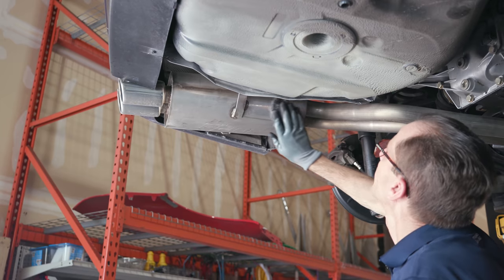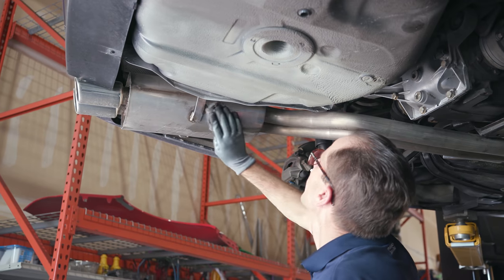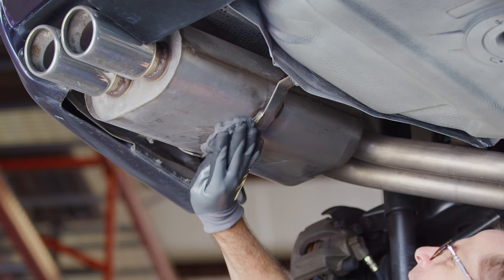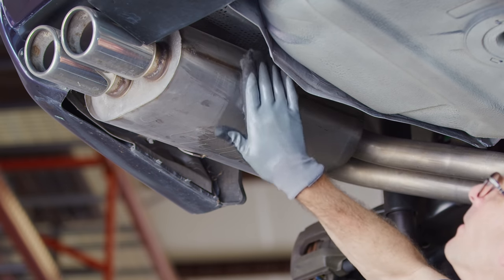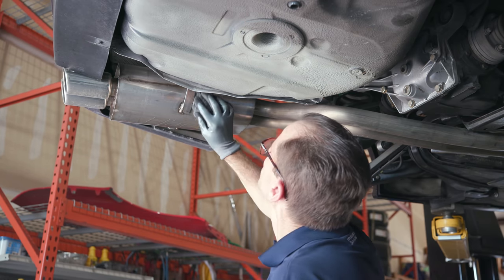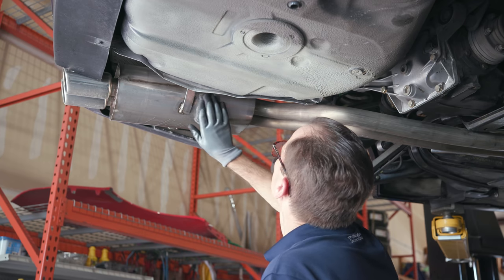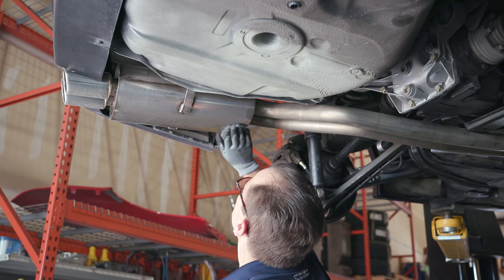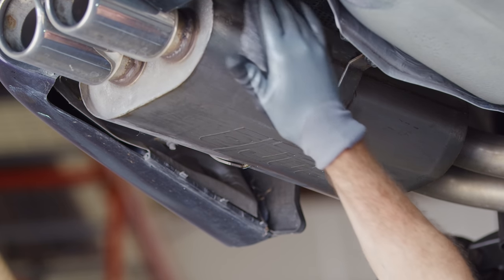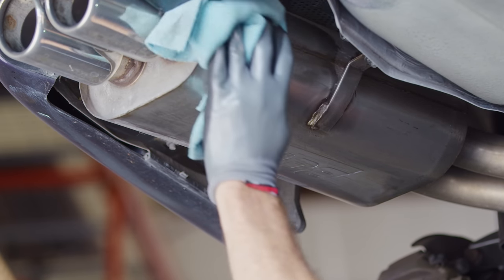You see, it doesn't take much. Now, Borla has got a, it's not a polished finish, so I'm not going crazy here. It won't take much to bring this back. It really does a nice job on the welds, too. You can see that weld disappear right before your eyes. So I'm just gonna keep a nice, consistent, linear motion. It's quadruple-ought steel wool, so I've done polished surfaces with it. And so now I want to make sure to wipe it off.